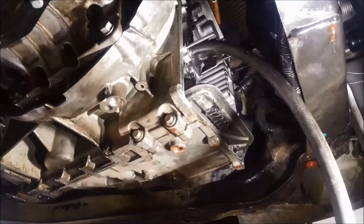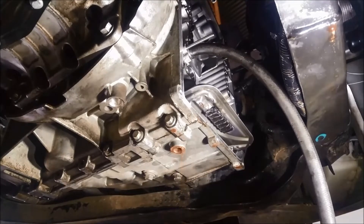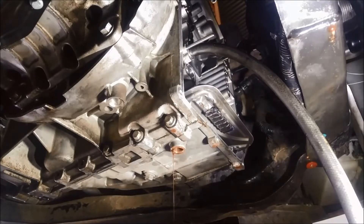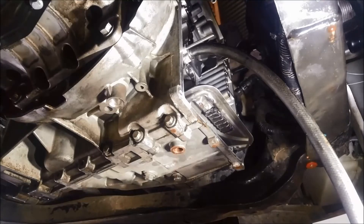I'm just going to blow some air through there. You can actually see the filters flexing a little bit. The best way to do it would be with some oil and that'll reverse flush it a lot more effectively. If these are filled with bits of plastic, that means the little plastic spring retainers in the dual clutches have gone, and this will be only a temporary repair until it gets blocked up again. That fine stuff will end up going into the valve body as well. Just showing you that you can reverse flush it just to get a bit more life out of the transmission.